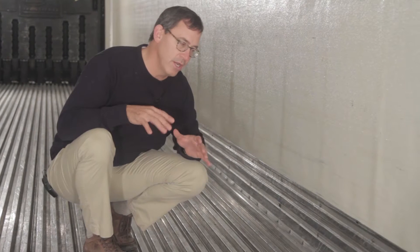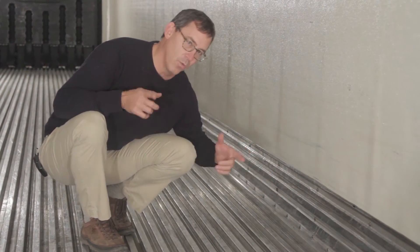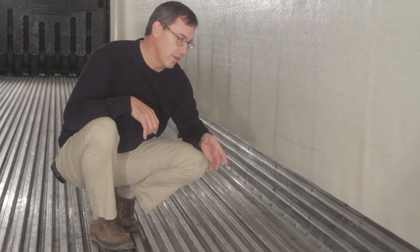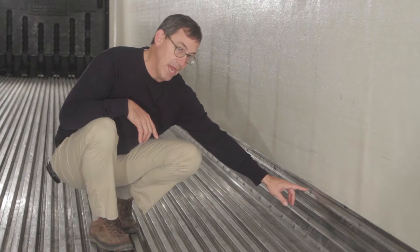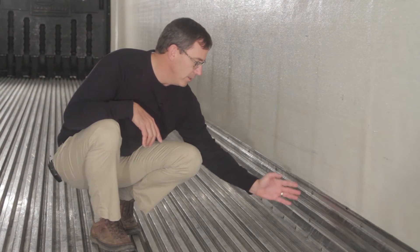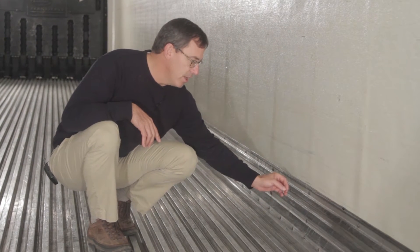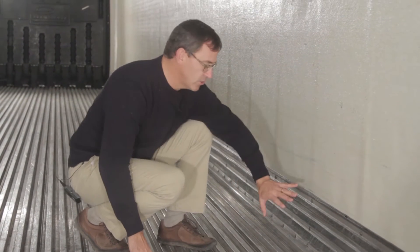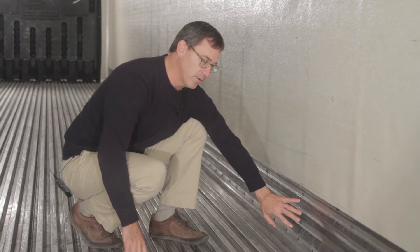It's different in a utility in that the end piece and the wear band are one piece. I also want to point out in this particular trailer or this design, they have fasteners that go through the wear band, into a wood filler, and then into the post. And that is in order to keep the wear band intact with the wall.